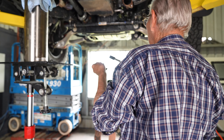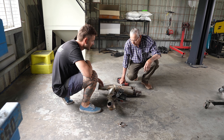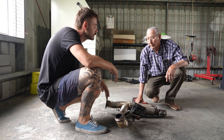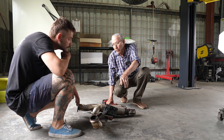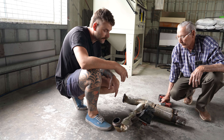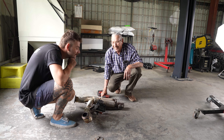What's your benefit of pulling this off? Because these aren't equal length? Yeah, and I've got to wonder if that's why it contributes to them sounding like they do — because these sound so much like a V6 Commodore. I want to try and improve how they sound, and I think starting with making from turbo to muffler the same length will help make them sound better — it'll equalize the noise. Like if you didn't have an H-pipe it'd sound like rubbish. It might even improve fuel economy too.